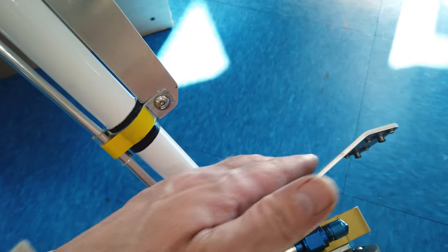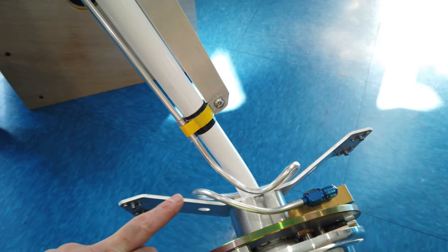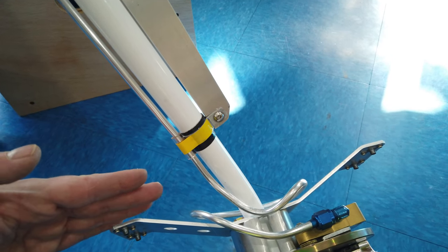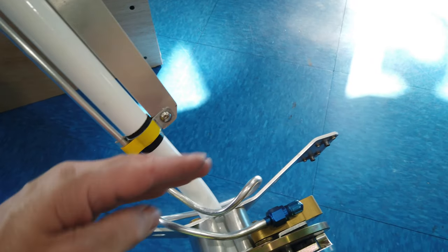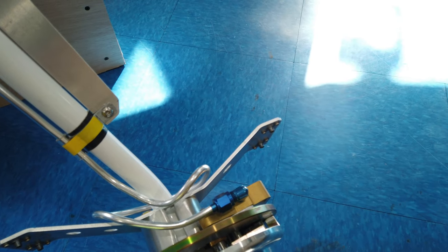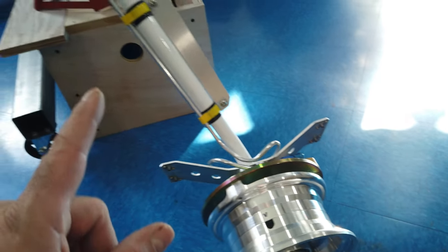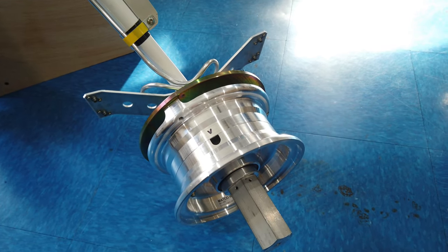At this point, you want to be sure that your brake line is inside of this bracket. You can imagine that the wheel fairing is going to lay on this face and this face, so you don't want your brake line sticking out beyond that. Let me grab these parts and take them over to the other side to put those together and see how everything fits.